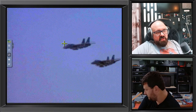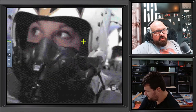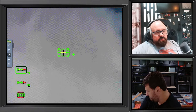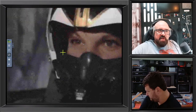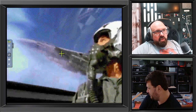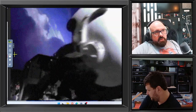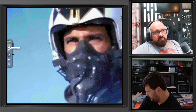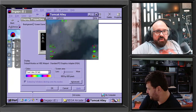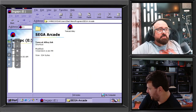Yeah, because the graphics card used in this is just the QEMU QXL card, and there's no driver for it in Windows 98. So I found some custom driver that was made that was meant to be pretty much for any graphics card that gave it 3D capabilities, and it seemed to work with the QXL driver. But you'll get much better results out of a real graphics card. Yeah, pass through, and you're getting close to a real machine then. 50% of the machine will be real with the sound and GPU. So okay, cool.